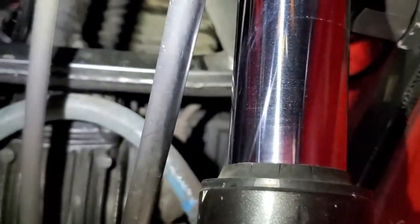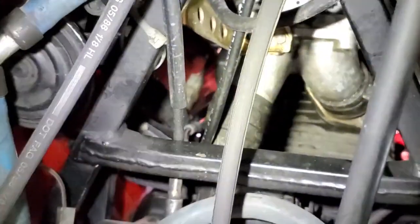Both legs have this issue. And I don't know if you can see way up inside there — that's the intake manifold right there, a little bit to the fat pipe top right. The lighting is terrible, but you can see how wet it is. You've definitely got a leak up in there.